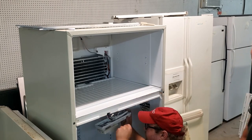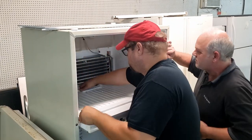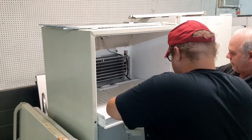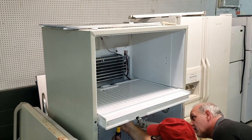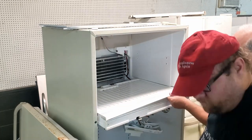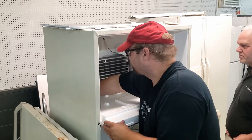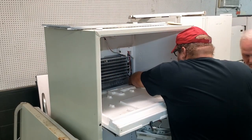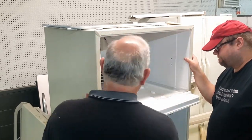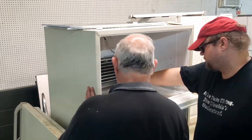The piece separating the upper and lower portion is plastic on top, styrofoam in the middle, and metal on the bottom. The styrofoam has small air channels inside that take cold air from the front bottom of the refrigerator and send it to the front and back of the freezer — but these channels are rather small, meaning air is heavily restricted. Greg also noted that the thermostat wire needs to be removed from the back of the unit where cold air is strongest and placed to the left or right side so air is more thoroughly mixed. We could theoretically remove the entire shelf except the front bracket, but that would require rerouting all wiring and expose wires, making things far more complex.